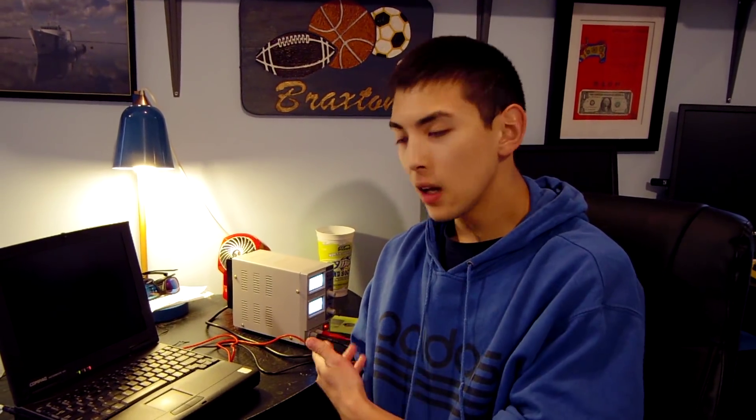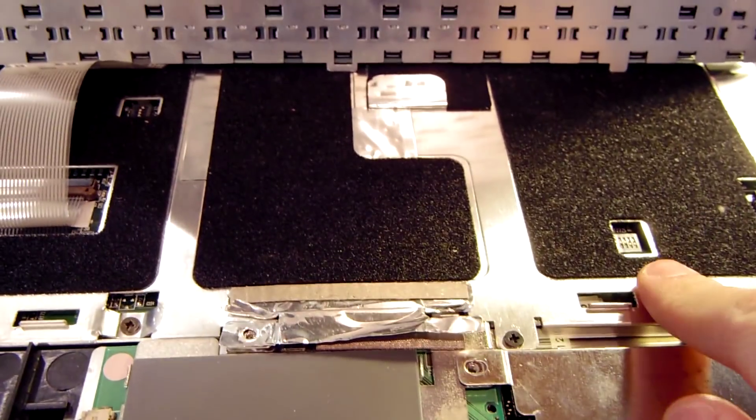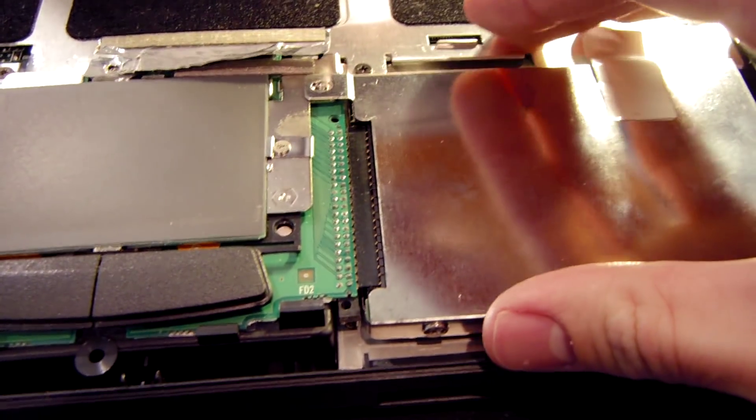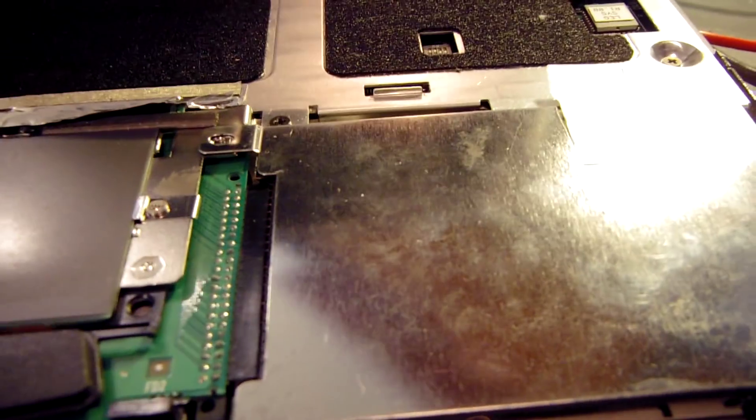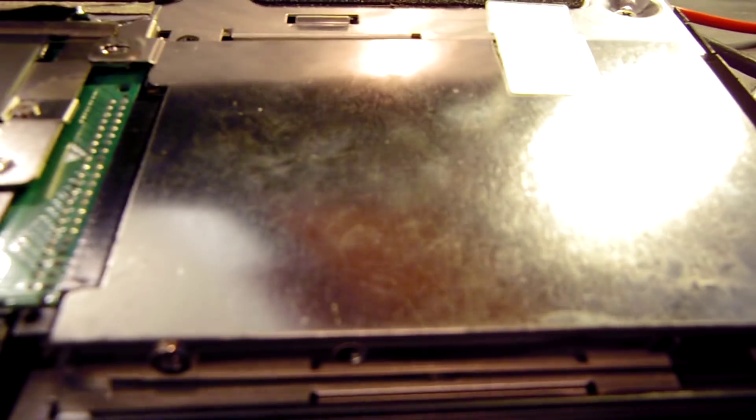I plugged the system into my power supply, powered it up, and got nothing from the hard drive — it didn't even spin up. I think I need to disassemble again, because the hard drive is connected to the trackpad board, and during the overview the trackpad and mouse buttons didn't work either. The previous owner might have simply unplugged something. For the past 15 minutes I was playing with jumper settings to see if they'd do anything — they didn't. Then I pulled the hard drive out slightly, and now it does turn on.